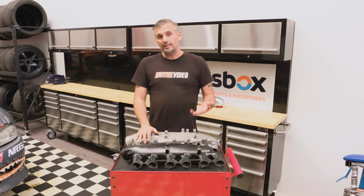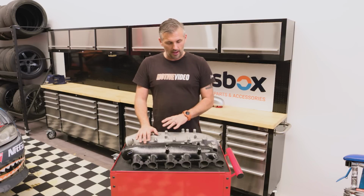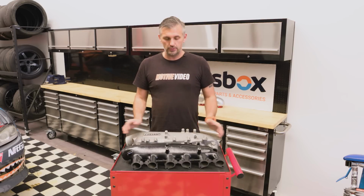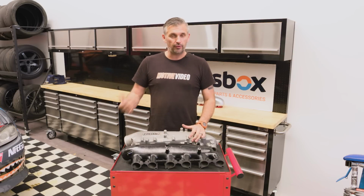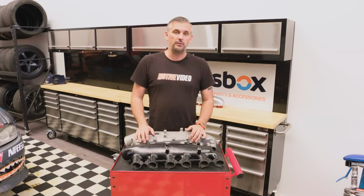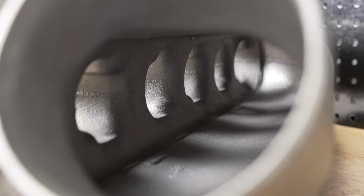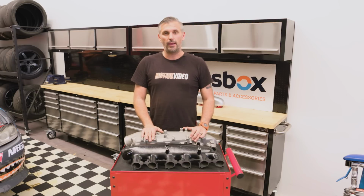So honestly, that's the reason why we're not going to bother fitting it and testing it, because all the experience we've had in the past with this inlet is that it is all about top end power. So if you have a 1,000 horsepower turbo and you want to look old school JDM in your engine bay, this is the go. But our setup right now with 800 horsepower, 3.2, super responsive for its setup, means we'd probably just go backwards with this. We probably wouldn't lose any outright power, but hey, we might at this power level, just due to the fact there's no bell mouth, the inlet isn't smooth, so I just can't see how this is going to give us any benefit on the power level that we're on.